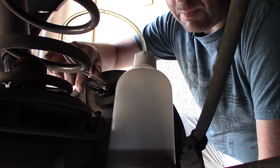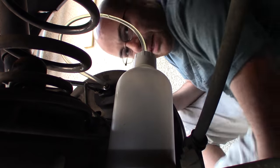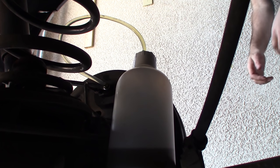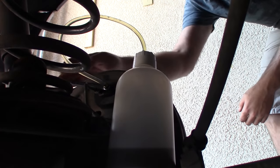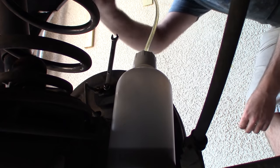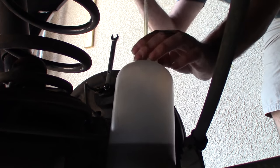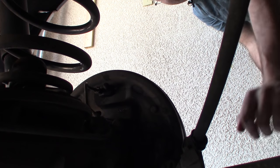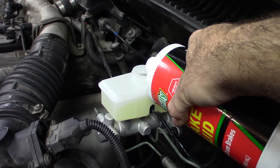Anyway, I'm gonna open this back up and stomp one more time. Make sure we've got all the air out of there. Down, up, down, up. And it looks pretty good. Close that off. Let it drain. Cap back on and move on to the next one. Once again, topping off that fluid.